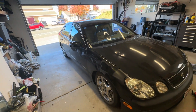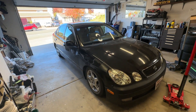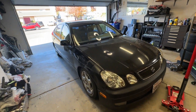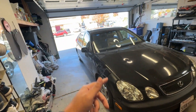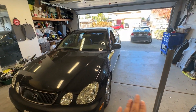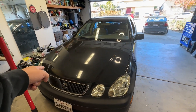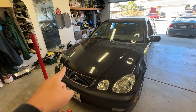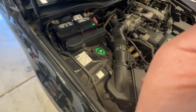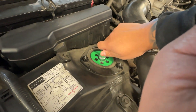It's a new day and honestly it got kind of dark and I was tired yesterday. Today we're going to make sure everything's level — we have an alignment appointment at 12. I want to show you guys the final results because with this wonky alignment, the toe is crazy off and there's a hella camber in the rear. The front alignment I kind of leveled pretty good, but I just want it a bit more even because one side is a little lower. We're going to raise it by a couple of spins. So it is 32-way adjustable — I'm going to set it to 16 for now.